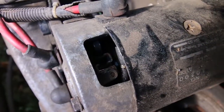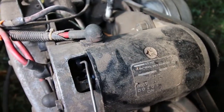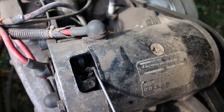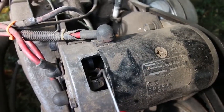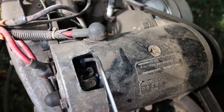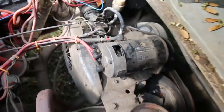Right down in there is this spring coil. It has an arm that comes over here into the brush holder. When you pull the brush out, that spring coil falls straight down in. So we're going to use this little angle pick tool and hopefully go in there and hook it, pull it back up out of the way, drop the new brush in, set the spring back down on it, fasten it back and it'll be good to go. That's the plan anyways.